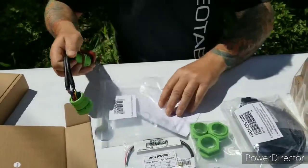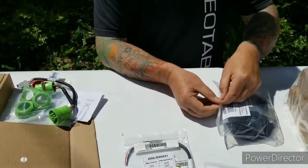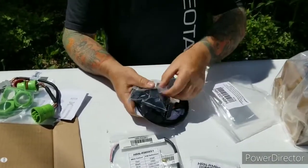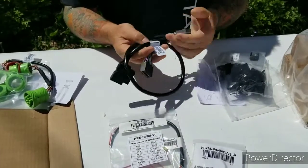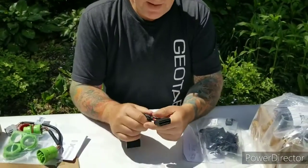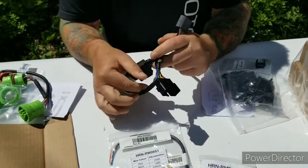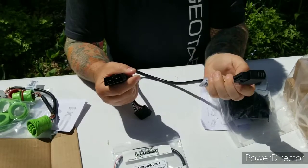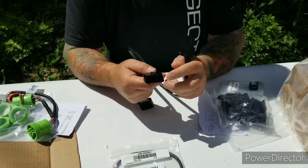You may have one as well, which may be the standard onboard diagnostic port, much like you would have in a passenger car, a pickup truck, a van. So inside of this, you'll have the same basic 3-way T-harness as well. So one end of this will go back out the native port of the vehicle. The device will plug in to this end, and you'll plug the native port of the vehicle into this end here.